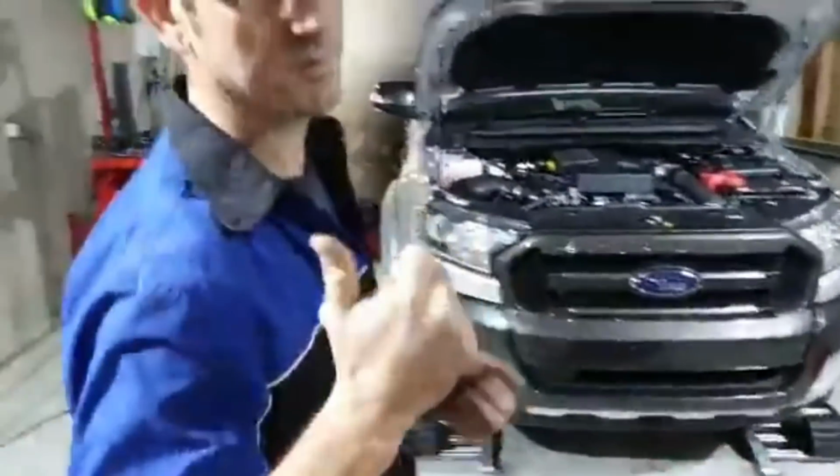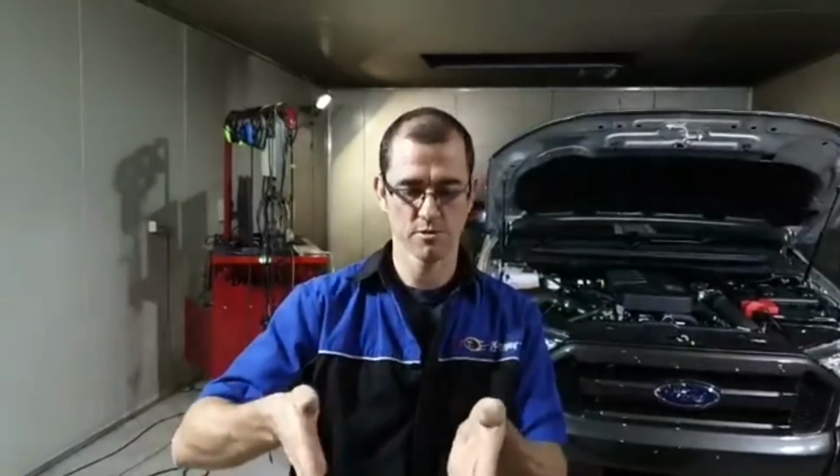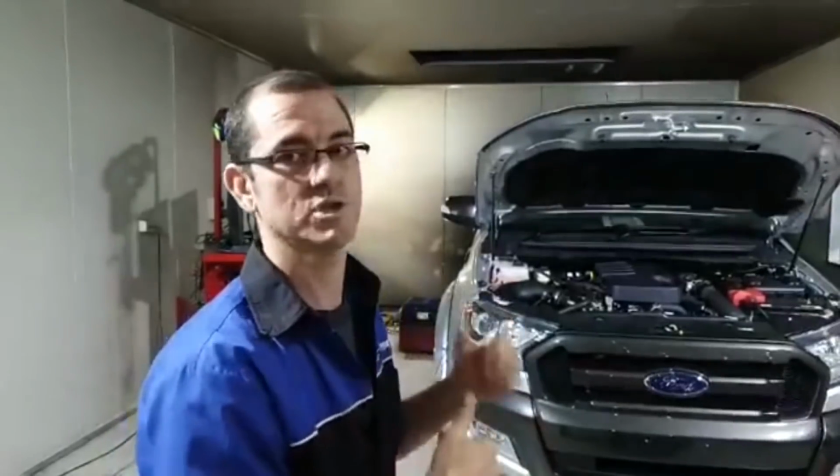Yep. Right, so first of all, when we run the car on the dyno, you're going to see the car rear up onto the top roller. The idea behind this is we don't want to drive on the idler that is not doing the read. We want it to be on the readout roller, which is the front roller. So you will see the car drive up onto the roller, and we'll do a power run. It's going to get noisy, so we're going to turn the fans on. We'll do a run and we'll show you that one.